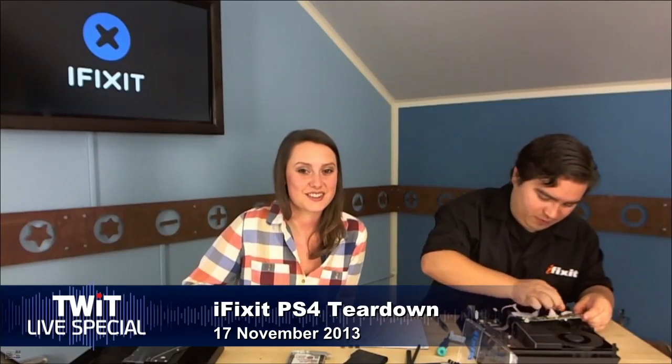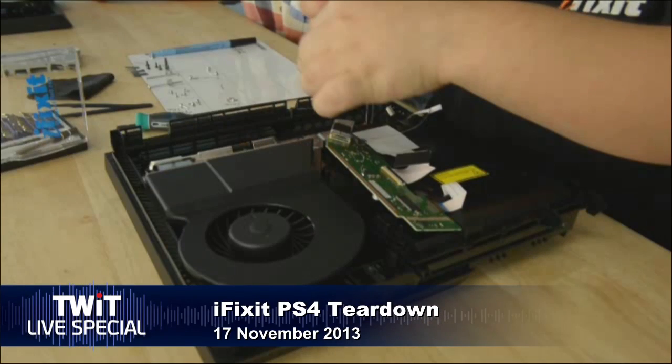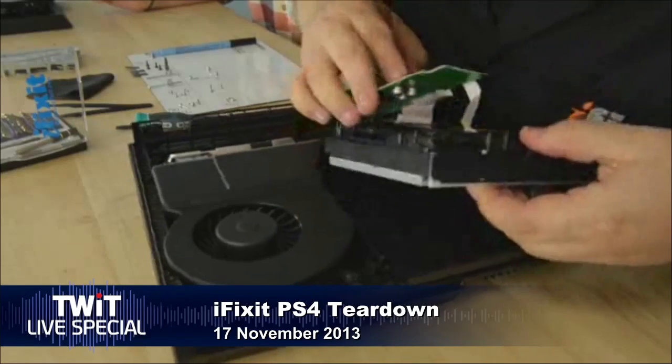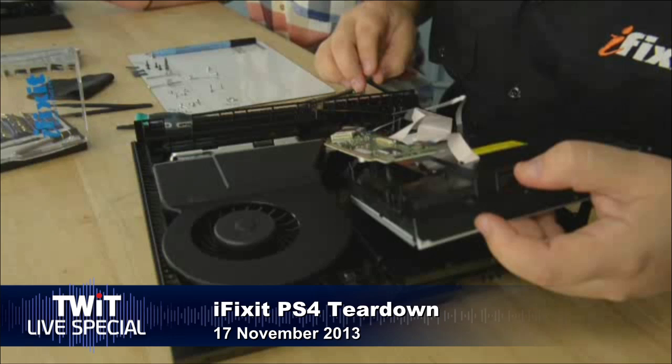Torx has never been proprietary in that sense — there is an ISO standard, which is nice. Torx head screws resist cam-out better than Phillips or slot head screws. Phillips heads were actually designed to cause the driver to cam out to prevent over-tightening, whereas Torx heads were designed to prevent cam-out. With automatic screwdrivers that limit torque, they can set a specific torque. Burke McQuinn, who does all our repairs here, is an expert on this.